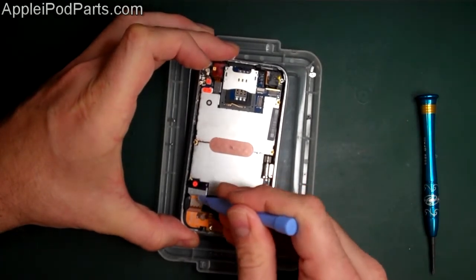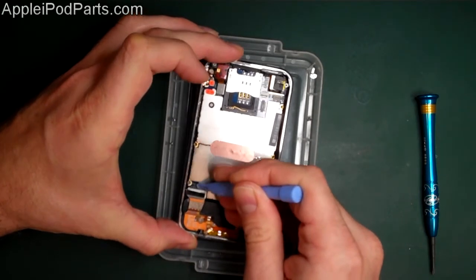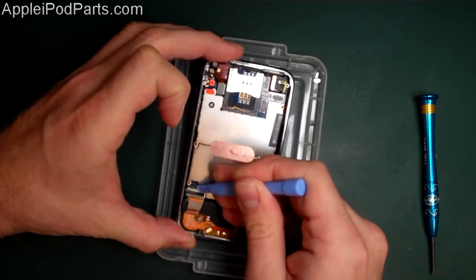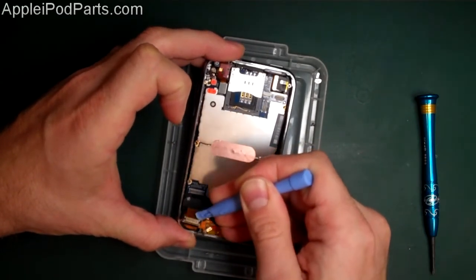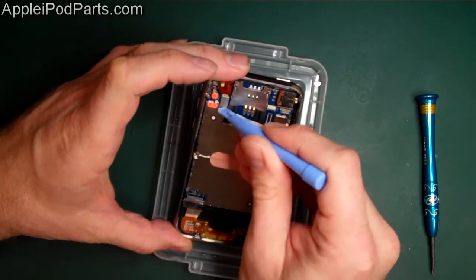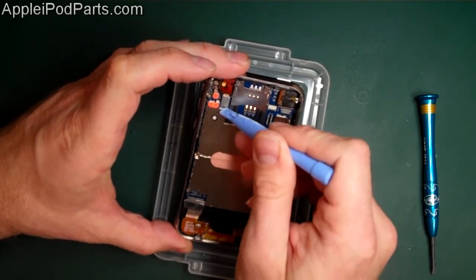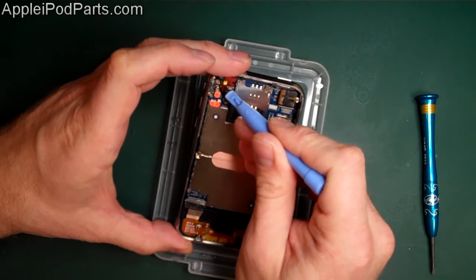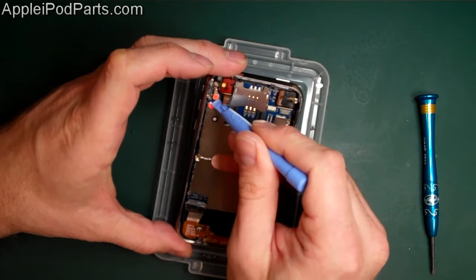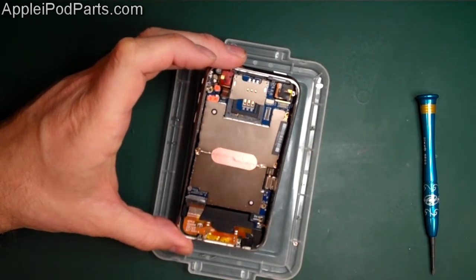That little black rubber label is skewed a bit off the top, so we need to try and get under there, lift the rubber off, and then get underneath there - mind you don't damage any chips underneath the connector as you go in, and it literally just pops off. So that comes up there. We're also going to remove these cables here. Now this little silver rectangle - that's for the headphone jack, the power switch, the volume, and the mute - so they're all the switchgear cables, that just pings up there. Number six is the WiFi that runs across here - very awkward to get on a circular connector, you want to be careful of those, they don't get damaged.